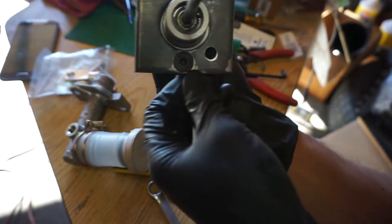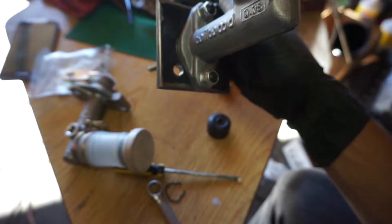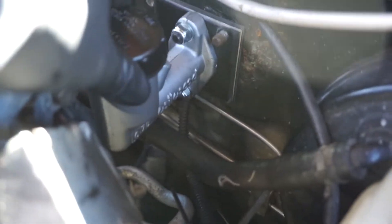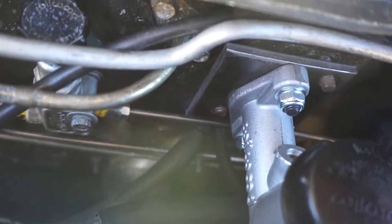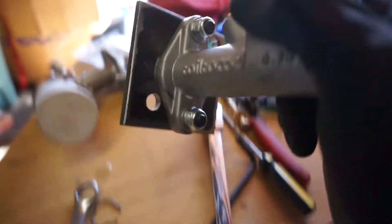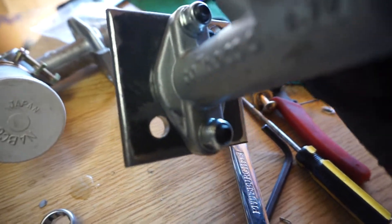The bracket is bolted on. When you flip it around, this side is going to be bolted to the firewall. I've got the plate into position — everything is clear and it still doesn't hit the throttle body. That stud is fine, but there is a stud right there causing an issue. I'm going to see if I can wiggle this around and tie it down. There is an issue — the locking nut is hitting, so I'm going to notch out just a little bit.